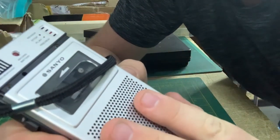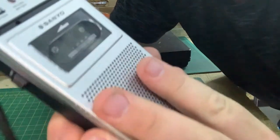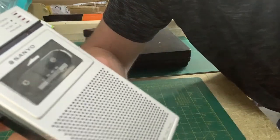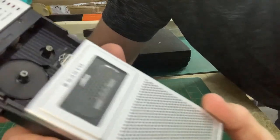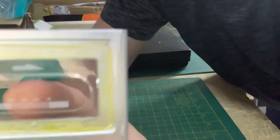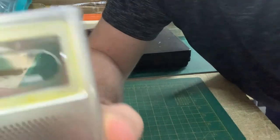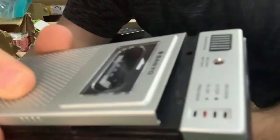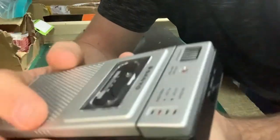When I was trying to pull the front panel down, it kept getting stuck and was literally jammed so it wouldn't move. The panel itself just moves down like so, and the cassette goes in there. On the back of the panel there's a plastic sheet, and the glue had come loose making a flap, which was getting caught when closing the panel. As you can see now, it goes on fine.